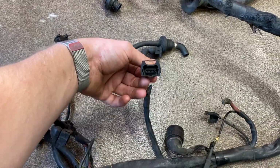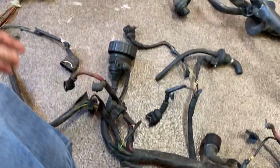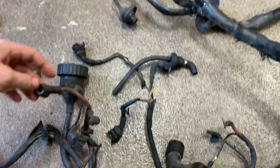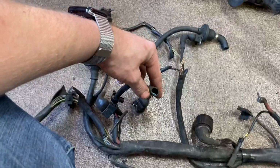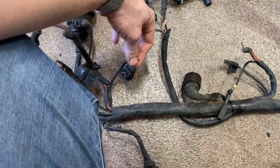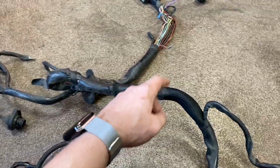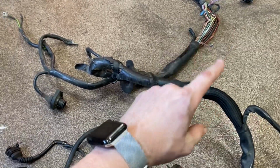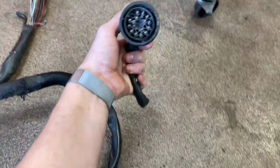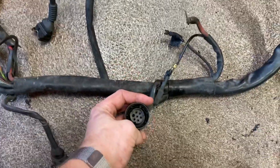I'm gonna get some electrical contact cleaner because a lot of the insides on these connectors are pretty blue. Yeah, just redoing things like the insulation on the AFM connector. I need a new eyelet ring terminal on the alternator exciter. I think this is oil pressure. Not too surprising that that's clipped, given how difficult that is to run. The grounds are pretty blue. I still need to get a tach wire because this is an 87, so I'll have to remind myself where that black wire is. But the C101 looks pretty good. Just again, electrical cleaner. O2 sensor thing looks okay, and even the injector harness plug looks okay.